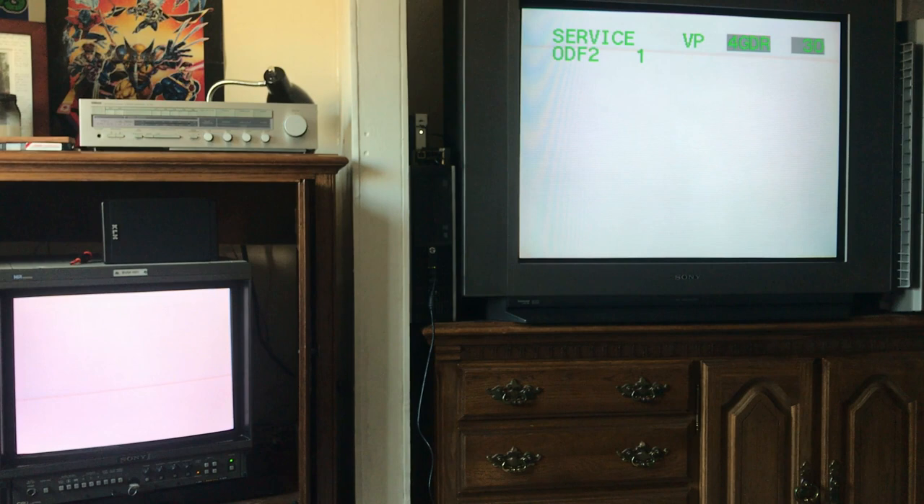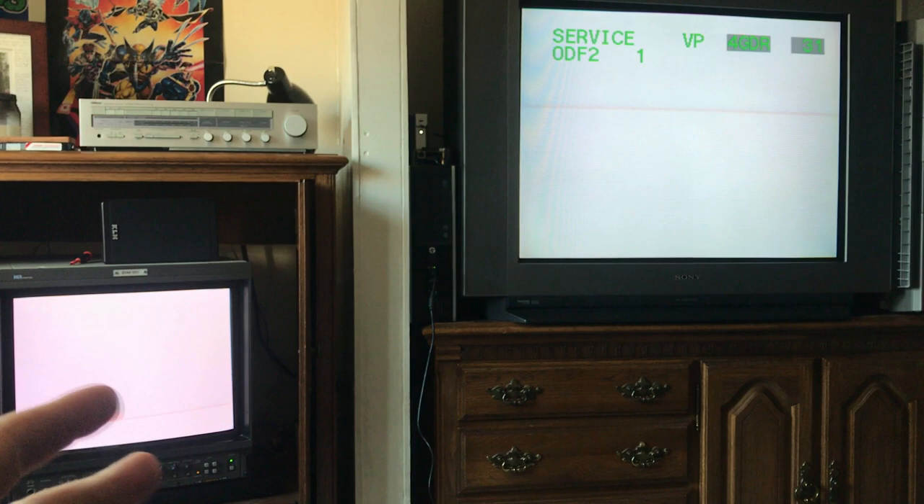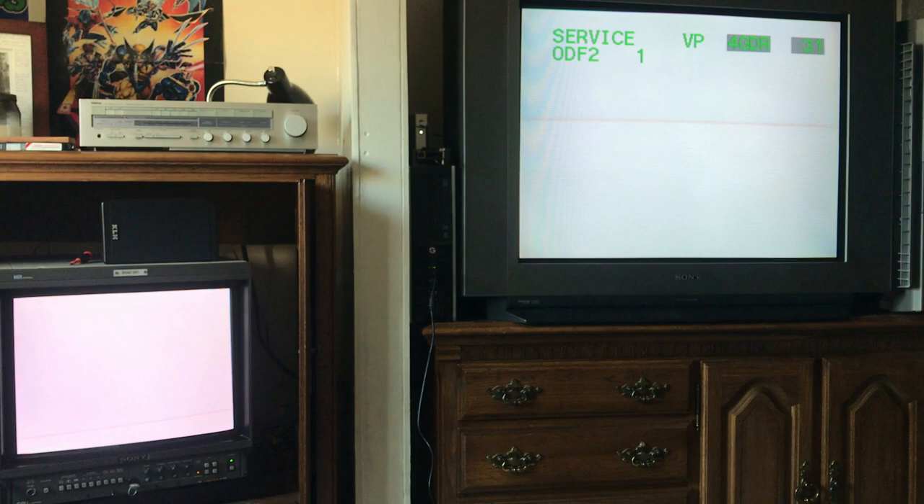After spending some time with this, I found the greens were a little wimpy, so I'm going to bump G drive up one, maybe two — let's try one. And that's it, we're done. Those are the adjustments I made, and I feel like this screen is less blue than it was. It matches the reference better. The white balance on my phone won't make it look exactly right in the video, but you get the idea.